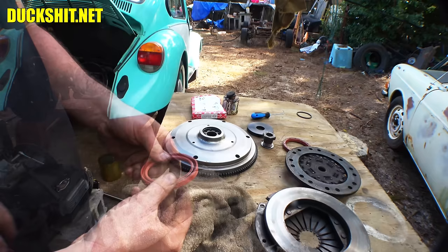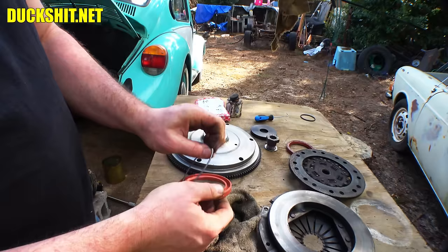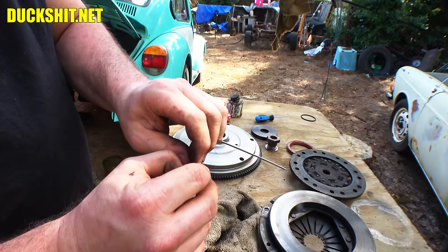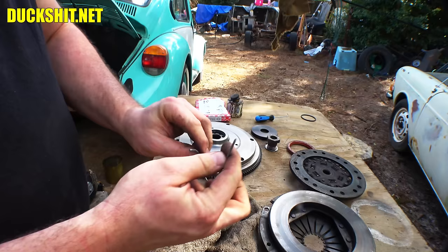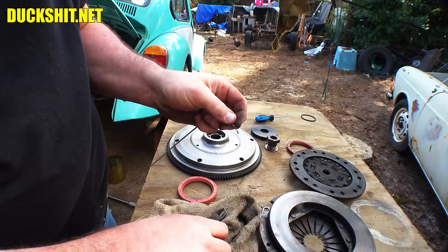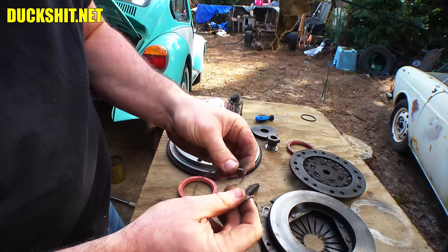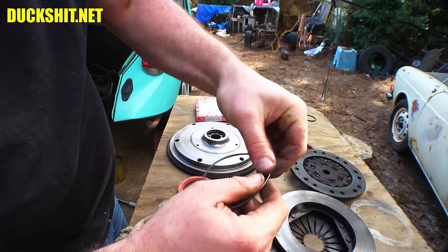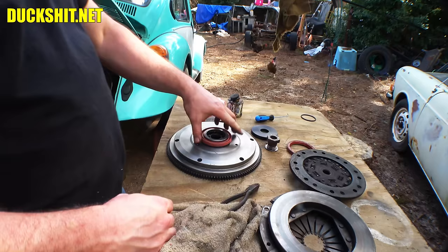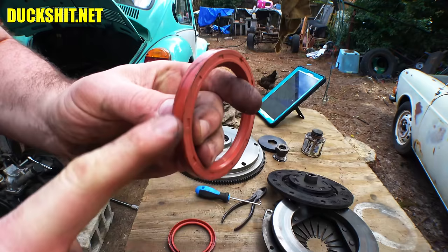This is a little trick that comes from Gary over at VW Jawbreaker — subscribe, link's down below. You can find where the seams are in this little ring and actually unscrew them. Then you stretch this back and cut just a little bit out of it. It allows you to cut it back and you can still screw it back in — and now that this ring is smaller, it's going to squeeze the seal a little tighter on that flywheel, which gives you a better seal. Thanks to Gary at VW Jawbreaker for that trick.